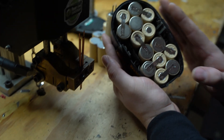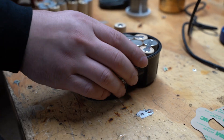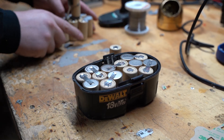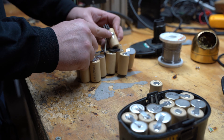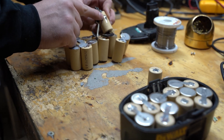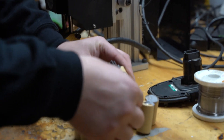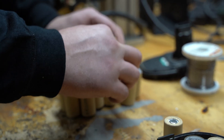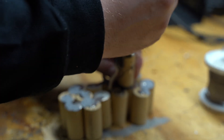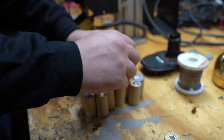All right, this is as far as we're going to go in this step. In the next step I'm going to show you what we're going to do with these. So we got our battery put together here — this is our single cell. The only thing we'll need from this old battery now is the top connecting piece, and then this is the thermostat that gets connected to the side, to the negative. And you definitely want this riser — it'll sit underneath here, and without it these batteries can short and actually will not make a good connection to the charger, so you won't be able to charge the battery because it won't be sticking up far enough.